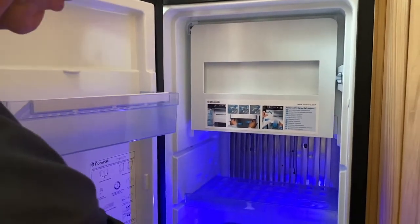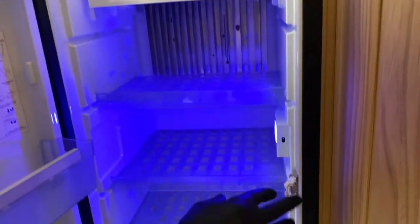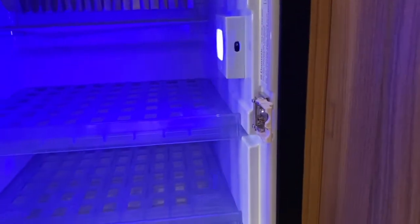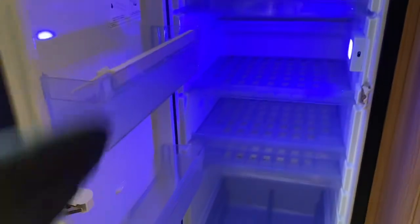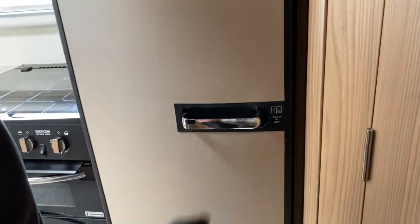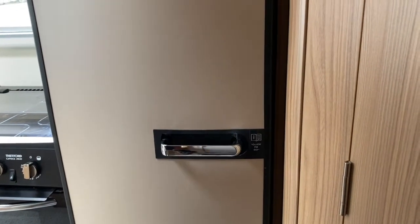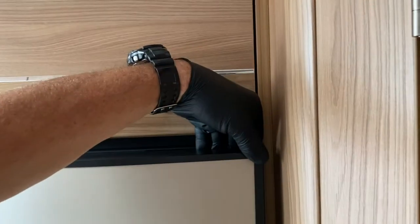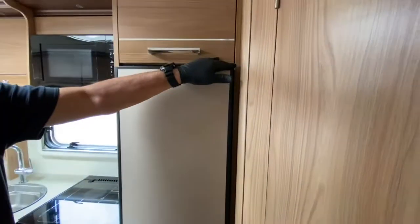The other item I want to point out to you is this little latch here. Be careful - it's only plastic and it can break very easily. It's the latch that you use to keep the door ajar to stop mildew from building up. You can see I've got a little bit of movement but it's latched and it's not sealing. My fingers are in the gap here - if it's not sealing the door won't close properly.